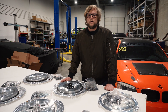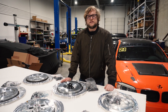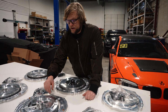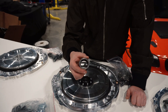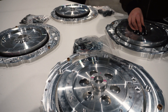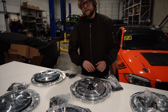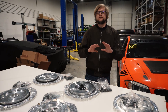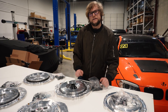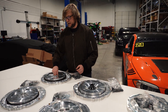They can take way more torque — I've seen over 1,000 on the stock 70 even. Super available, super inexpensive, super great. I don't have a bad word to say about them. These adapters are all made the same way and include custom rings for using both the older and the newer style converters. They come with two different versions of the converters — one has a small nose, one has a big nose. All these little rings let you order the adapter kit and be good to go on whatever sort of transmission you find. They're all pocketed out to look totally sweet, come with all the hardware needed, and are completely bolt-on with the custom flywheel.